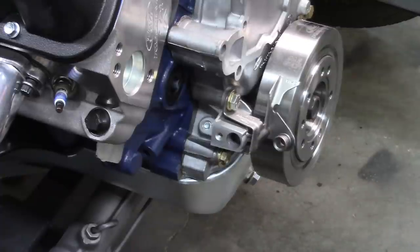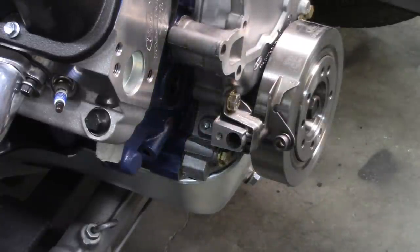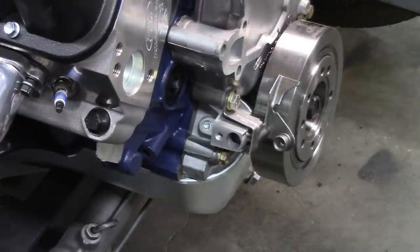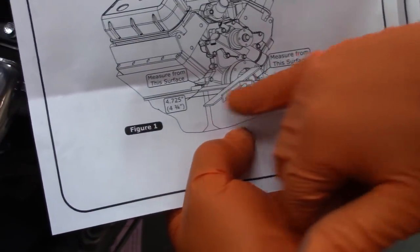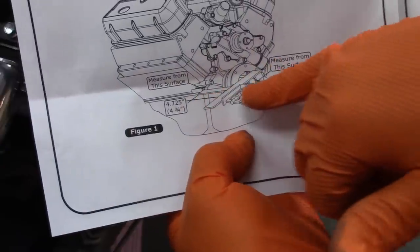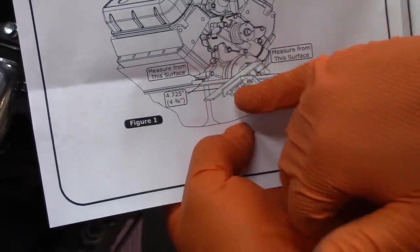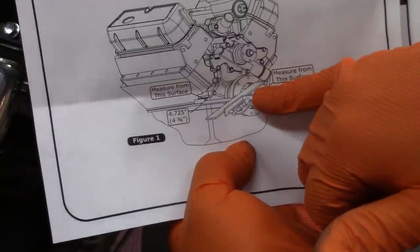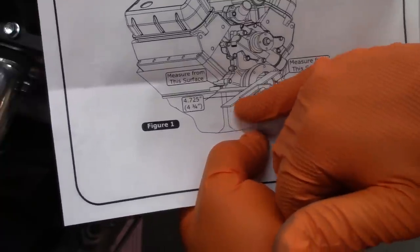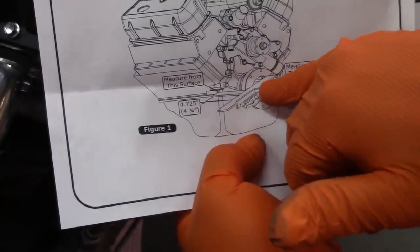Okay. Then it says, and it shows in the picture, to take a straight edge, and if you look at how this is drawn, it's a pretty good representation. A combination square running with the length of it making contact with that little space. And this straight edge is because you can't measure out in free space. So it's giving you something to reference the face of that pulley.